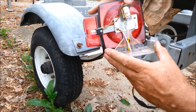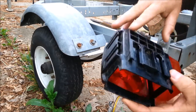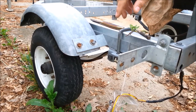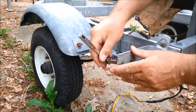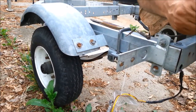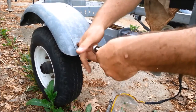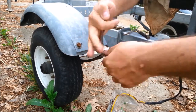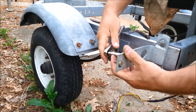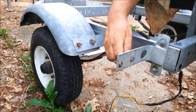Water could raise up in here a little bit and not damage anything. Your waterproof fixtures are usually designed something like this. This isn't ruined, so we want to go ahead and use it. The first thing I'm going to do is remove these fasteners. Oh, I didn't get a deep enough socket — this is actually a 10mm fastener. Notice there's a ground wire here, very common on a tail light. We're going to want to replace that.